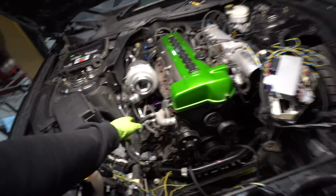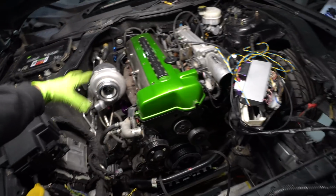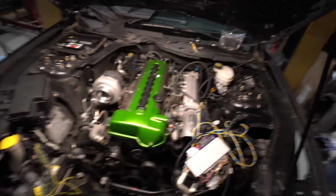But anyhow, Dave is over here and we're going to go ahead and pull the engine back out of it. I hope I don't have to do any stuff to the turbo manifold. Basically, I'm just going to try and loosen all the engine bolts and disconnect the wiring, and then just throw it up in the air and get the transmission out of it so we can do it on the ground. I don't think it'd be fun at all to try and pull the actual tranny in the car. You can't really get to the top bolts or anything. So if we ever do have to do a service at a track or something, or on the journey, that's just not going to be a good time.